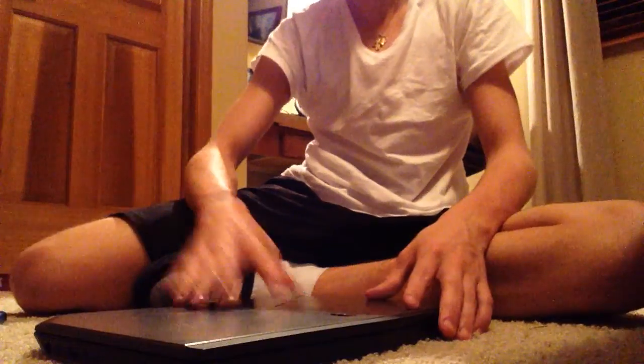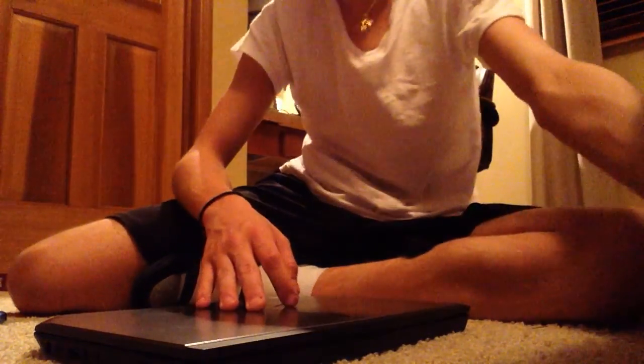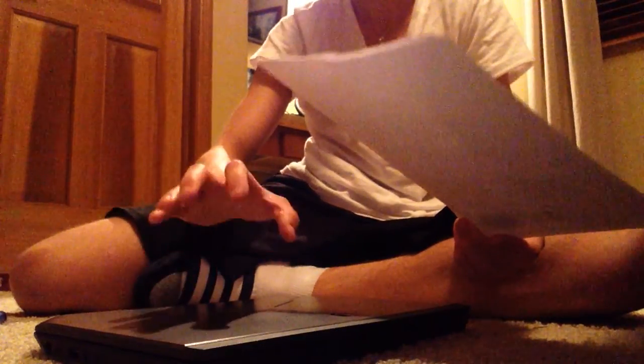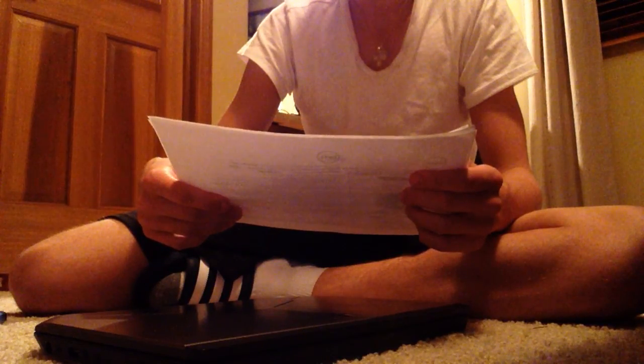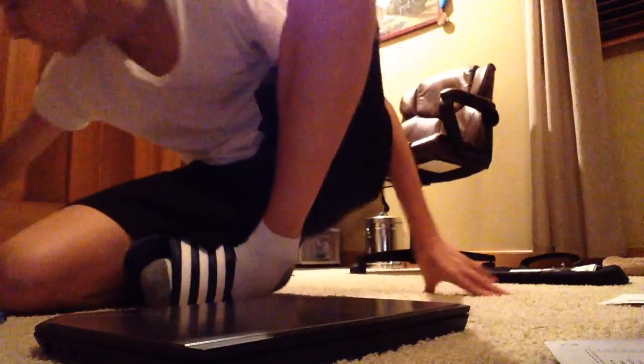Anyways, the PC would still charge sometimes. Sometimes it wouldn't. So I decided to call tech support, and I figured out that I had that 1-year warranty still. I remembered. So they have on-site technicians that come to your house to replace things. And at first he said he replaced the system board, DCM, and the AC adapter, so he gave me a new AC adapter. Windows wouldn't boot up properly after he changed it. So I eventually fixed it by booting the computer up in safe mode, and it worked from there.